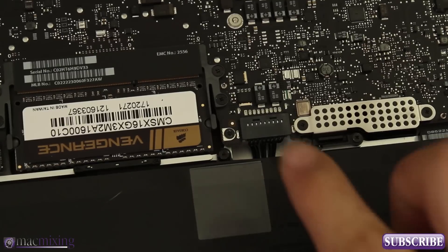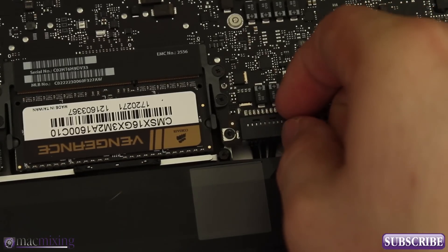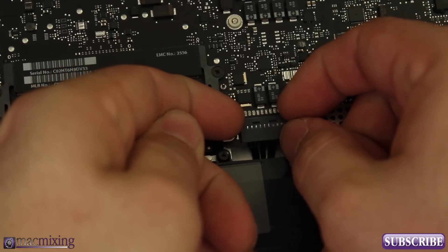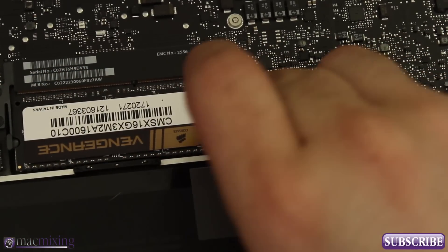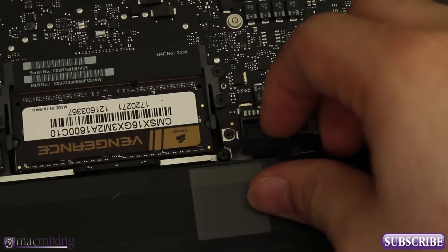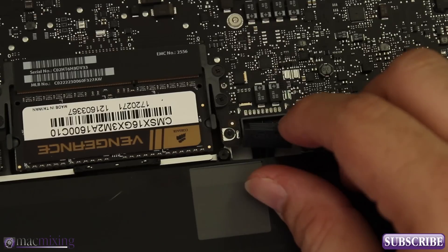The first thing we want to do is remove this battery connector right here. If you carefully pry up on the edges of it, very carefully, you'll start to get it to wiggle loose. You don't want to pull up too fast or too hard as there are pins under here that can break very easily. So be careful when you're taking this off — just make sure that you don't pull up too hard. Once you have that battery connector off, pull it back and make sure it's out of the way and not going to touch the pins.